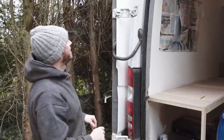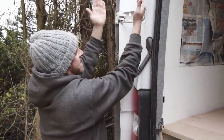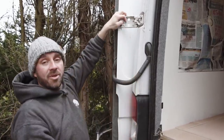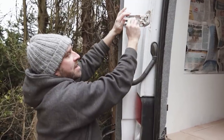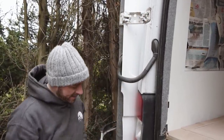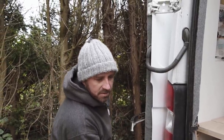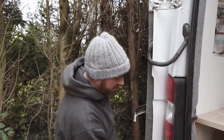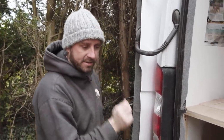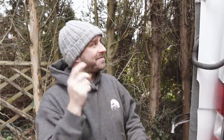All done. Cut it at an angle and then brought these two bits out and cut them flat. The pain is this still obviously moves, so I had to wedge a block of wood behind to cut straight. On my first attempt I nicked a little bit there, but it's not going to make any difference. Now I'm just going to cover all the bare metal in hammerite, file it off, cover it in hammerite, let that dry and then we can mount the wheel rack. Can't wait.